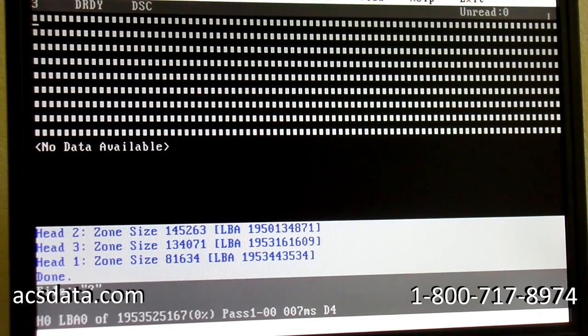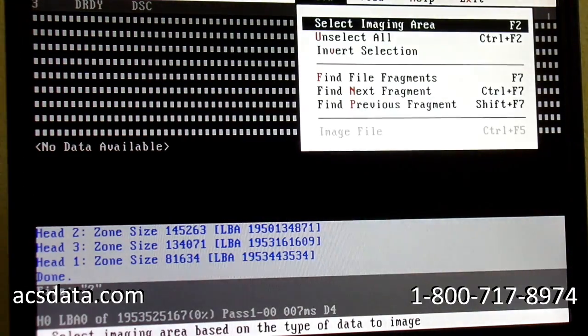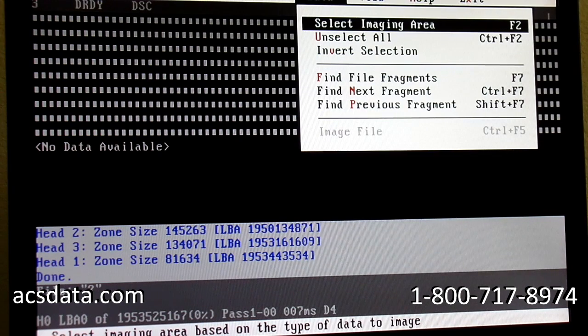And from here, we will go through and generate what's called a bitmap. And I can't stress enough, as far as doing this type of work, the actual physical part of replacing the heads, a lot of people can get a bunch of parts drives and just practice, practice, practice. There are plenty of sources out there for finding parts, like head combs and things to keep the heads separated, and there's little do-it-yourself information out there as well.